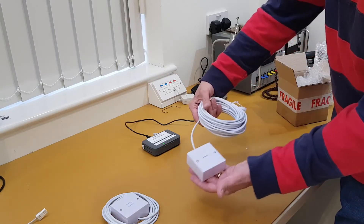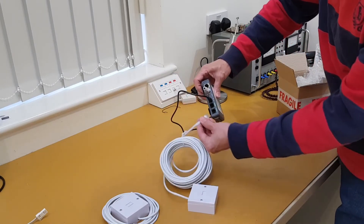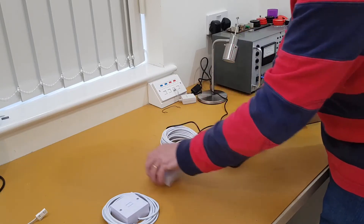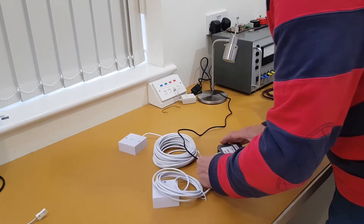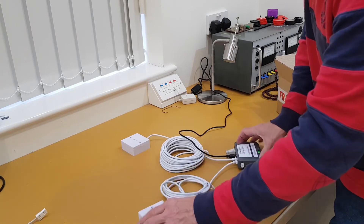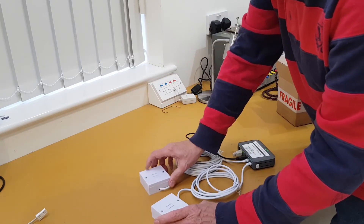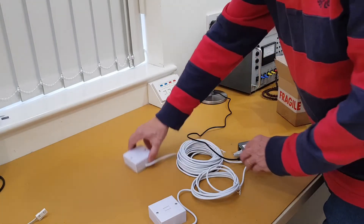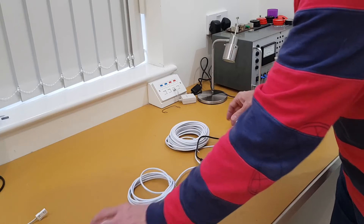While that's booting, we'll set up the other part. This is the longer lead. There are two ports at the back — two telephone ports. You can plug into telephone one or telephone two. I'll plug this one into phone one and the other into phone two. These use what's known as RJ11 connectors, but the sockets your telephone plugs into are standard UK sockets, euphemistically called BT sockets, even though they're used by everybody in the UK.